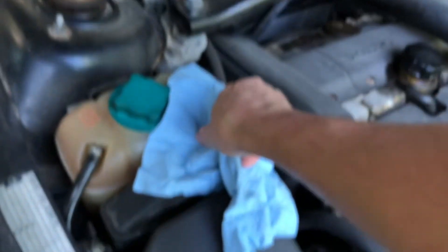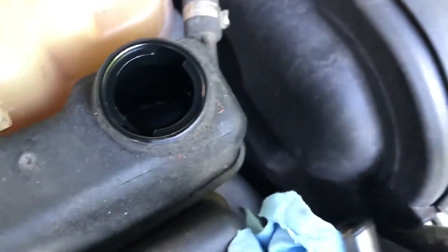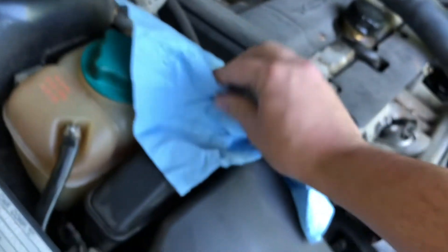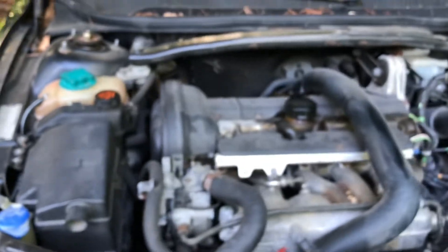It's making some weird noises, so I came out here to check the power steering fluid. Full. And that is low — so that's where that noise is coming from. One of the main reasons he sold the car to me was because it made that whining noise around turns. There's your problem — the pump's running low.